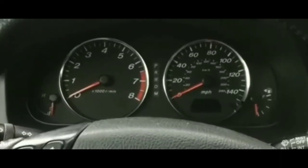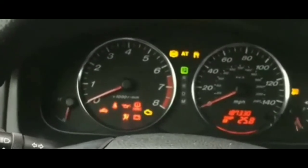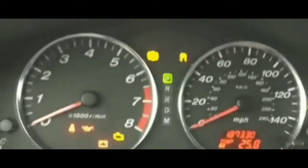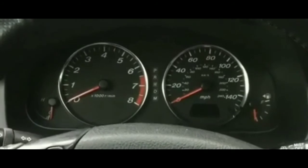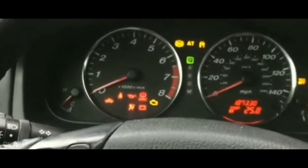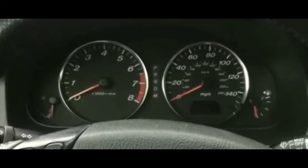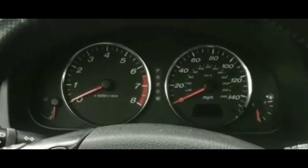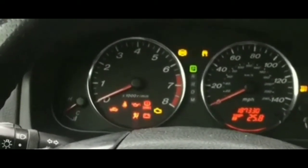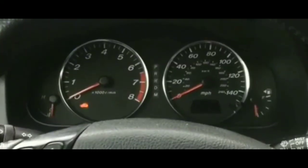It's always best to have someone else bump it while you try to start it, but I bumped the starter a couple of times with a crowbar I have — about five times total — to try to bump the starter and solenoid. I also checked the connection to the solenoid and starter motor, which was a bit dingy and dirty, but I don't think that's the issue of why it's not starting.